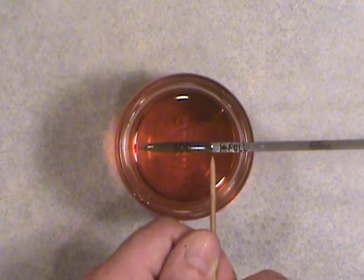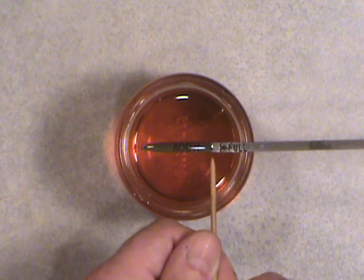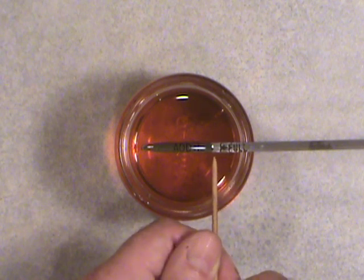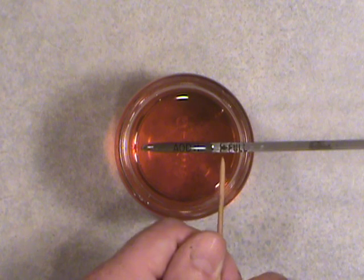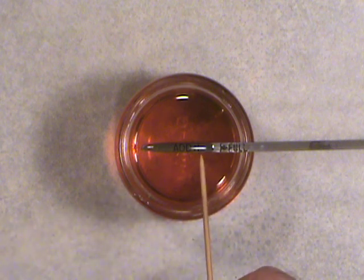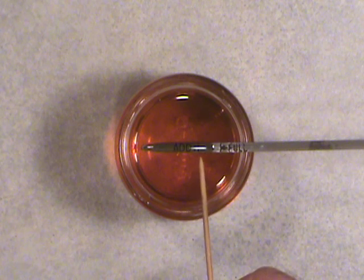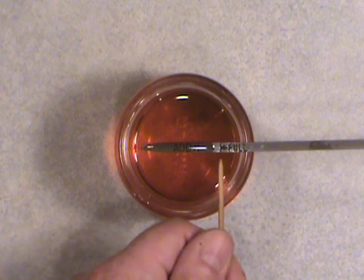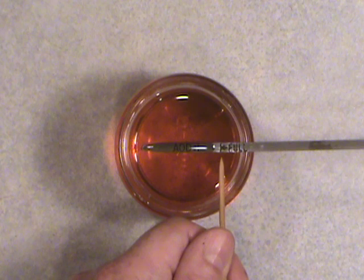Like I say, the most important part is to make sure the oil gets a chance to drain back into your oil pan, because if you do it in a hurry, you're going to have too much oil in your oil pan and you're going to have aeration. It's the crankshaft counterweights and the big end of the con rods, they'll be dipping in your oil and foaming it up for you. You don't want that. So there's my parting message here. Always keep your oil between the add and full, preferably at the full mark. Full is good. You know you've got extra capacity in your oil pan, especially at high speeds.